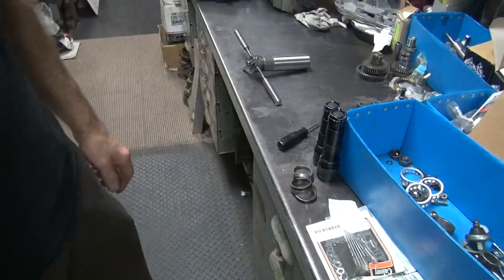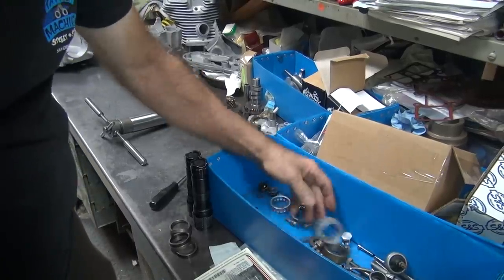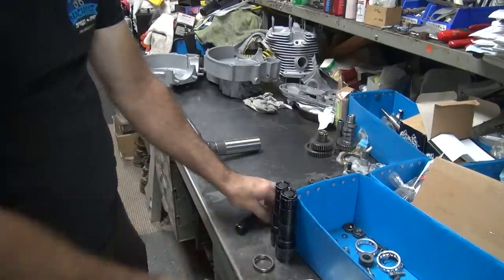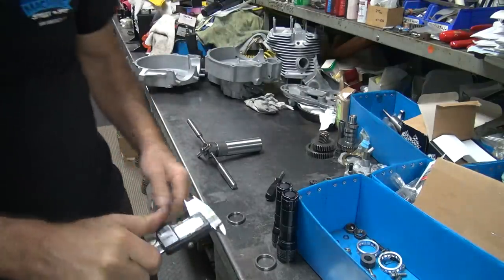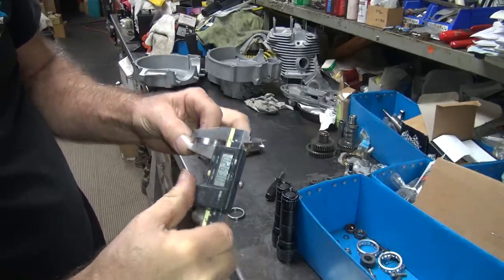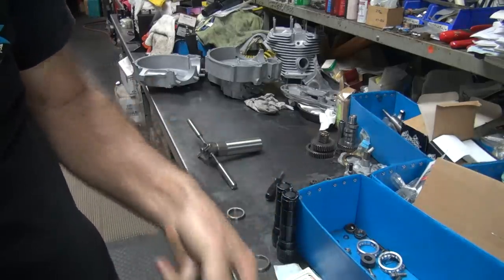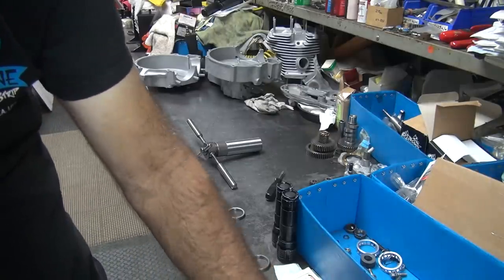So that's all I got the shims from. Here's the old one over here — there's your old spacer. You can set up your main bearings — those are mine, that's his old one, that's his new one. What do you think the differences are? No idea, none whatsoever. That's 259... 263... that's close... 268... 267. Maybe they're in order. 260... 265... 260. Now they're in order.